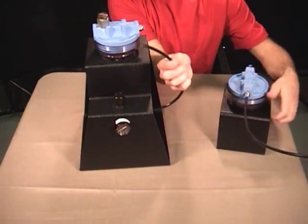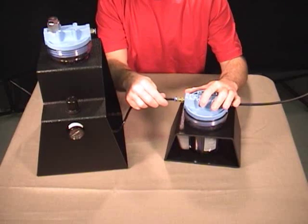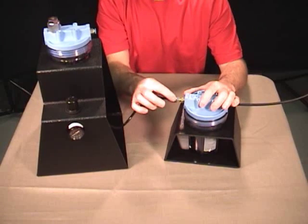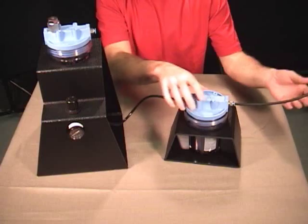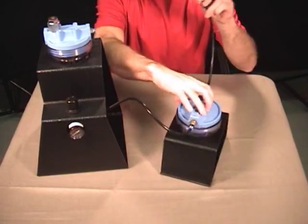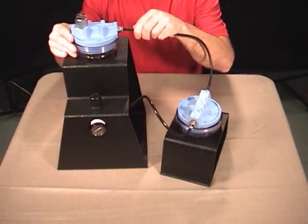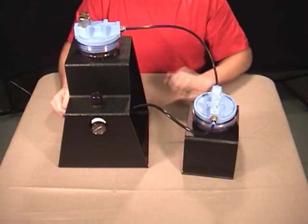From there, I'm going to take that tubing and push it into the in-port on the desiccant filter. All I'm going to do is just apply a little bit of pressure — it'll slide right in and the ring will lock it the same way the one on the lid does. We then take the tubing from the out-port on the desiccant filter and put it up to the lid where we undid the tubing from the back of the regulator. And that's it.